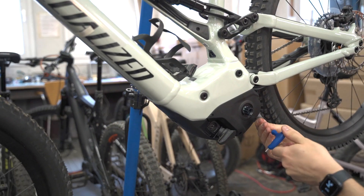Depending on the e-bike and its drive, you have various options for bypassing the speed limit. Tuning modules attached to the speed sensor are quite common: above a certain speed, the module ensures that the sensor only transmits half or a third of the actual speed to the control unit. One disadvantage is that the values displayed by your bike computer are no longer correct. Permanently installed tuning solutions or dongles function similarly to plug-on chips, and many do not falsify the displayed values. Most chips or modules do not interfere with the e-bike's programming — instead they simulate a slower speed for the motor control.